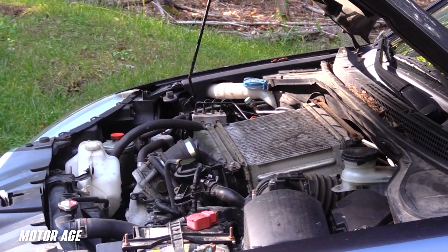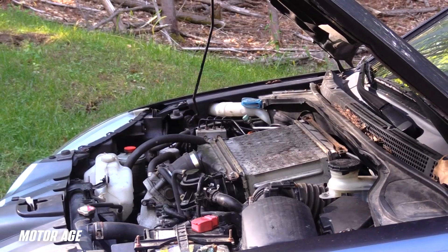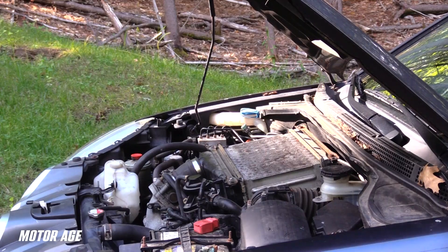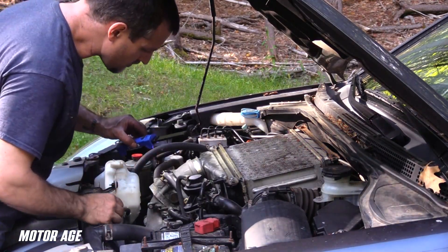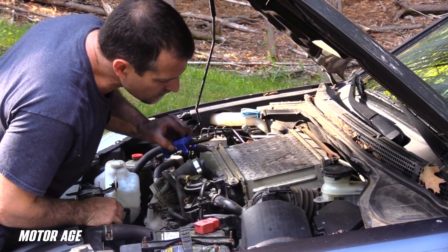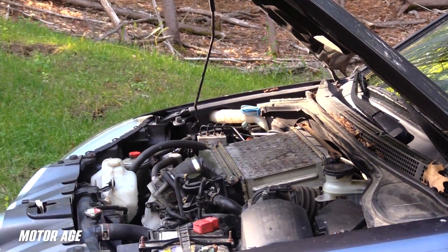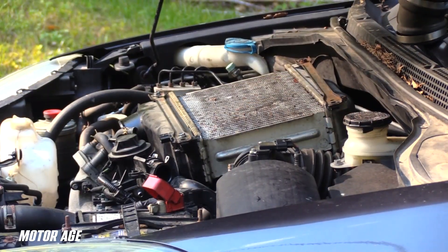Introducing smoke from a pressurized smoke machine will help make that happen. In the case of an induction system leak preliminarily discovered through scan tool analysis, we are guided by the results of our tests to begin locating a leak in the pressurized induction system — otherwise stated, the cold side of the turbocharger from the compressor wheel leading to the cylinders. Locating these leaks visually can be a chore, so we would typically begin with a thorough visual inspection of what can be accessed under the hood.